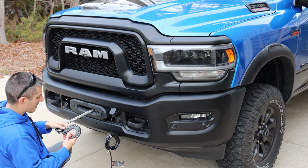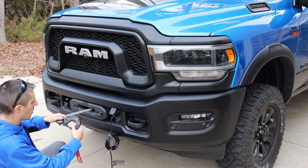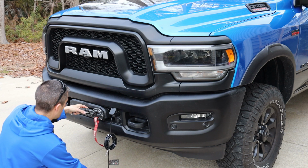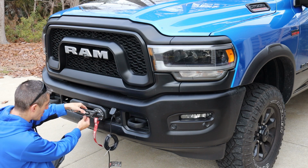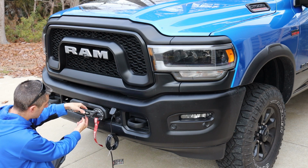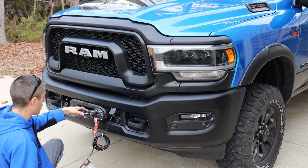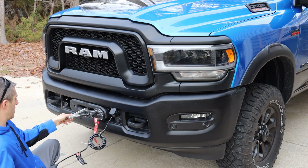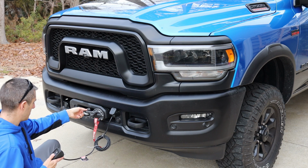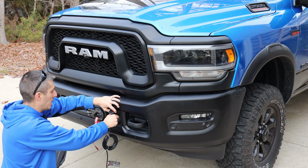The way that it came from factory, okay, there's a W for the worn and it says 3/8. That's how I attach it. I put it just like that. You have it the way you want it. There's a little cotter pin here. Make sure that it is not going to dig into your fairlead. Make sure it's just facing straight up and down. Then all you're going to do, make sure your hand's not all in there, and just bring it on in. There you go. Now make sure you remove the plug.